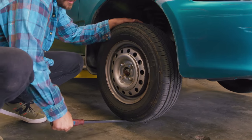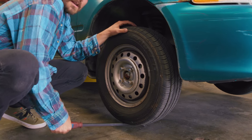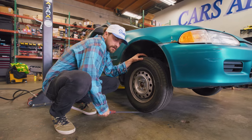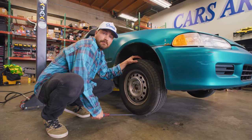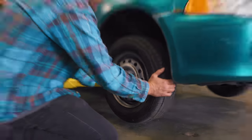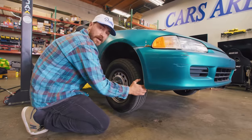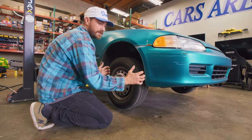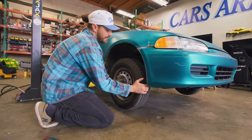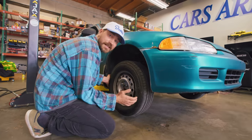Not bad. What you're looking for there is clicking at the ball joints. This has an upper and a lower ball joint. When I do this there's no play, so they feel okay. Next thing we're going to do is grab the tire at three and nine and just shake back and forth. That feels pretty bad — there's something wrong there. There shouldn't be any play or clunkiness, and I am getting some pretty significant clunkiness. That's usually indicative of a tie rod.